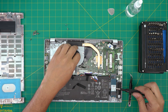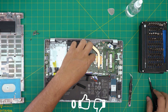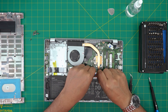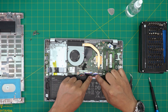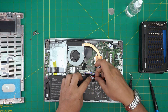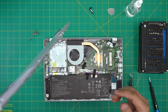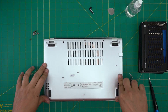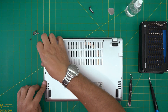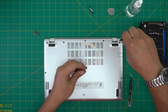Once the heat sink screws are in, place the fan back and put in the two screws for the fan. You can put gaffer's tape over the fan cable, but it's not necessary. Grab the battery connector and make sure it goes in evenly and pinch it together. You can apply new gaffer's tape or skip it. Then grab the bottom cover, bring it over, push down the corners, the sides, and all the way to the back — make sure you hear those clicks. Finally, grab the bottom screws and screw it down.